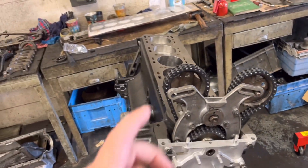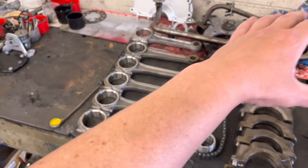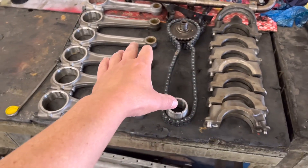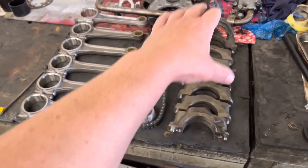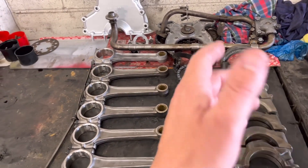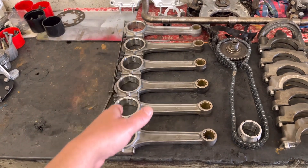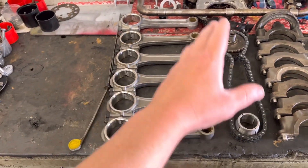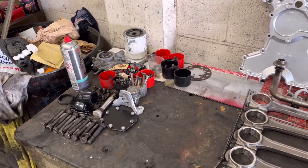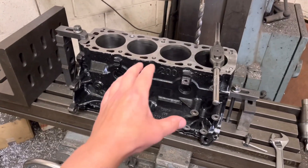On the second Jaguar, Isaac's cleaned up all the existing bits — the old bits that we're going to use. We've got all the caps there clean. The chain kit — although we're going to change the chains — he's cleaned up the set-up and laid it out as it was when it came out, just so he can remember when he puts it back together. All the rods he's blasted, torqued up. We're just going to measure the housings, probably size them, then balance those rods. All the nuts and bolts are laid out and labelled as to where they go.